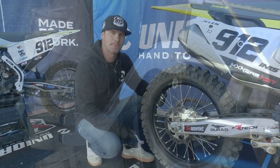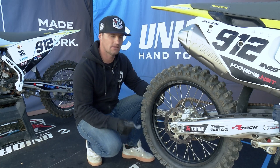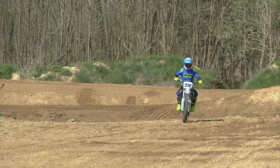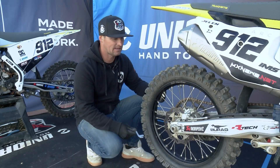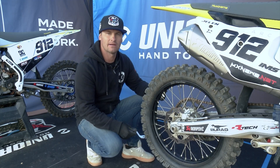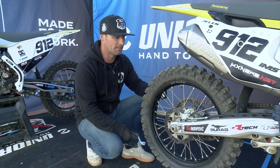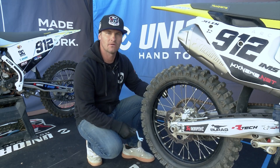So we fixed our problem, but I recommend that each time you go out riding you check your spokes, because we can cause damage when we lose or break some spokes — we can break the hub, and of course we can also crash really badly. So I recommend that you check on this every time you go riding.